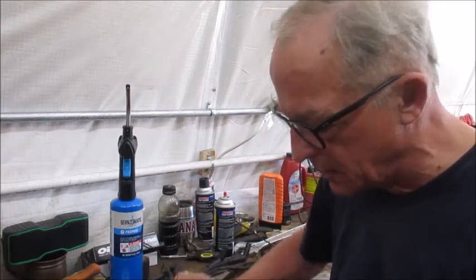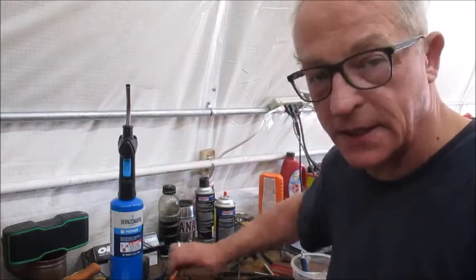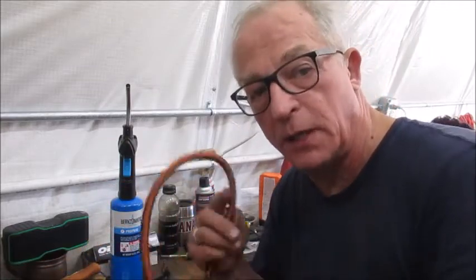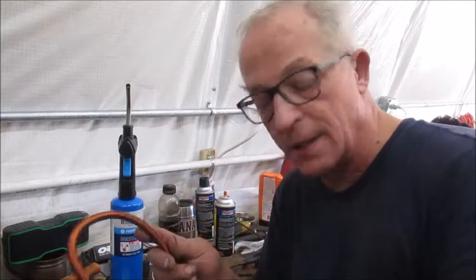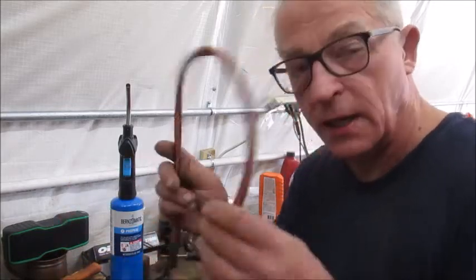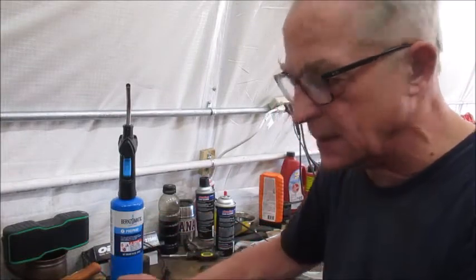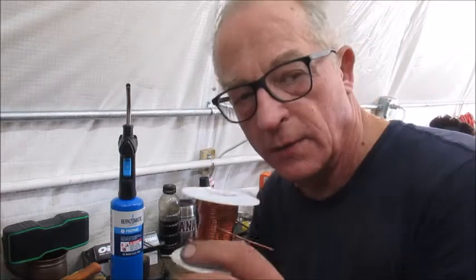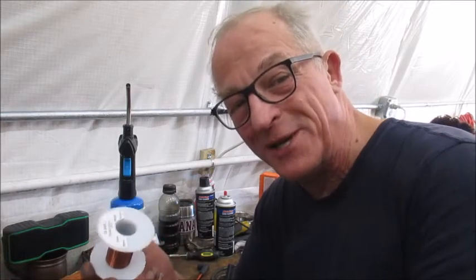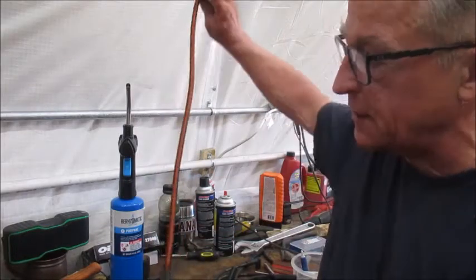What I'm doing is taking the plug wires and wrapping them with 16 gauge wire. If you guys do this, let me tell you it's taking me over an hour on each plug wire. So there's not gonna be a lot of you who want to put that kind of time into it. But if you do it while sitting on the couch or whatever, get a new set of plug wires and you can do this. I used solid core copper wire — I call it speaker wire — but I didn't realize how much work it was going to be.